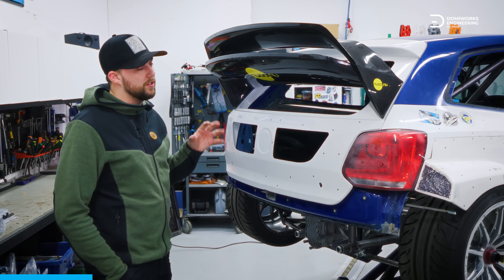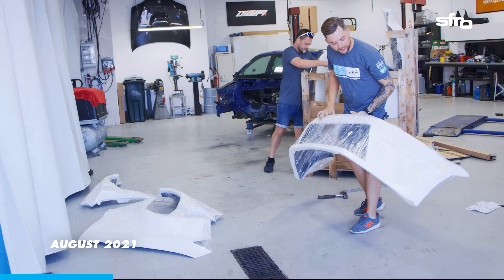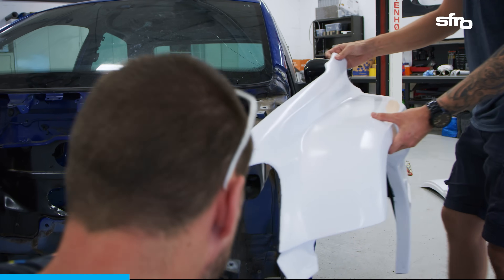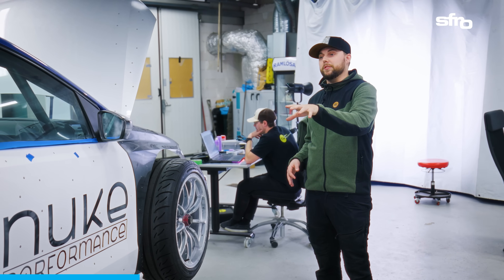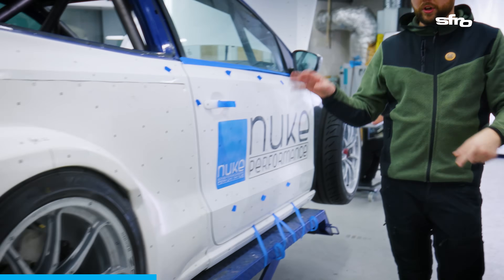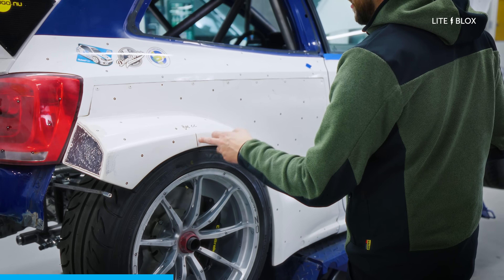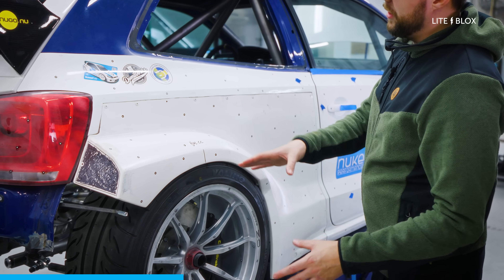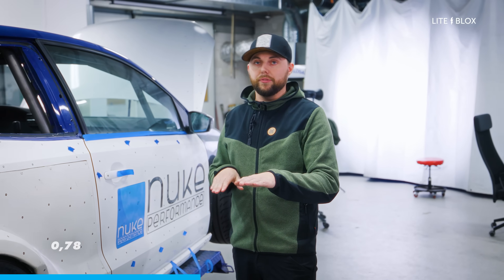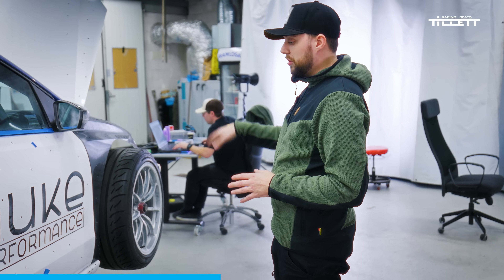When we bought the initial body kit for the car, we got rear fenders, front fenders, front and rear bumpers, and so on. The rear quarter panels were good in terms of where the actual wheel aligns to the centerline, but on the front side it was way off — about 20 millimeters. I don't know what that is in inches, but 20 millimeters is a lot. So we couldn't use them.